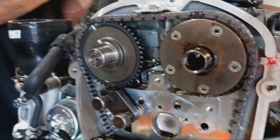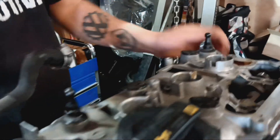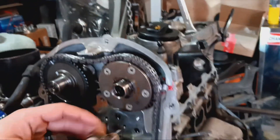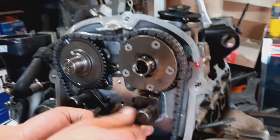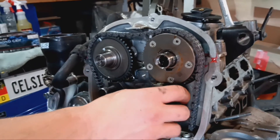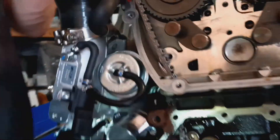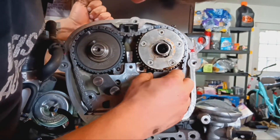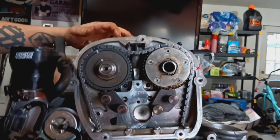What we'll do is really take the cam and put that one there, and on this side the same thing. Now these kits are really well made. If you order the one off Amazon or from AST, you will have to grind the back side of this one down — for some reason it's way too big for the kit. I ground mine down and it works perfectly fine. Then we'll rotate this, keeping that tooth on. We can't go one tooth over. So both of those are lined up, and then on the bottom — there it is.